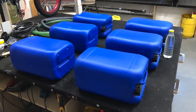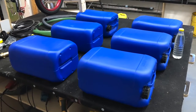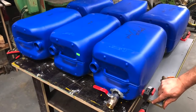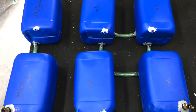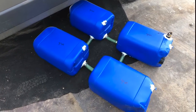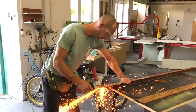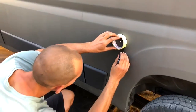There are plenty of pre-made campervan water tanks that you should use. I personally would never do a water tank inside the car if there is an option to have them underneath — the reason is of course space saving. I'm on a tight budget so I'm building my own tanks out of barrels. I'm connecting four 25-litre barrels together to create a 100-litre fresh water tank and another two together to make 50-litre grey water. These barrels fit perfectly under the car and I welded a supporting frame for them so the tanks are covered, protected, and pushed hard against the car from the bottom.